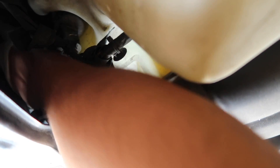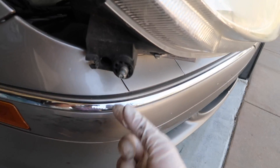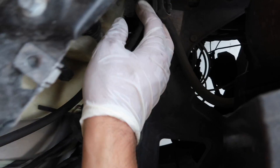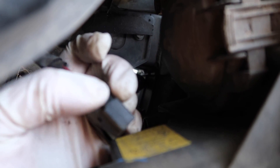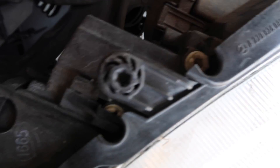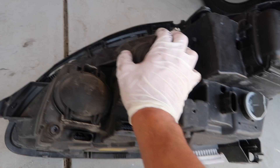There's another one at the bottom right there. Now that the headlight is pretty much out, this ball joint right here was the third mounting point for this headlight. We took out two wires right here — here's one, here's another one, and there's a third one right here. There's a little tab on top, actually on both sides, so you would have to press both of them down. But that's the last one. So now you can easily take off the headlight to expose it in order to change your bulbs.